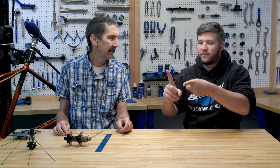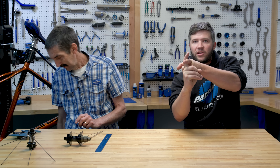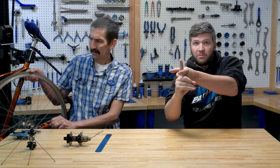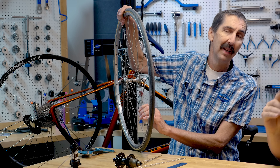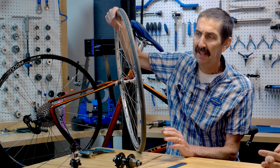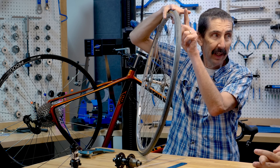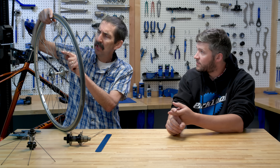The theory is you have spokes that are crossing, but they're not super straight - when they cross they bend a little bit, so they essentially become springs. When one de-tensions, the other one straightens and takes up any reduction in tension in that spoke - sharing some of its tension back and forth. You can see this if you're riding a really low-tension wheel - the tensions bottom out and you get a creak. That squeak is the interlacing rubbing.